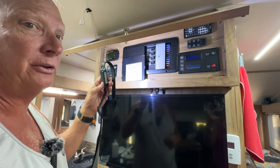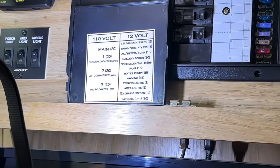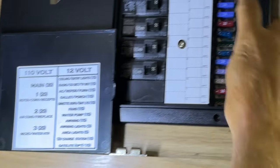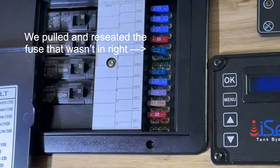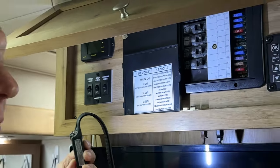The first thing we're going to do is secure the power. On a 2023 Host Yukon, go to where it says fans — which is fuse six one down — and pull the fuse. The way I verify the power was off is I had the motor running, and when I pulled the fuse the motor stopped, so I knew I had the right fuse.